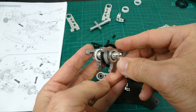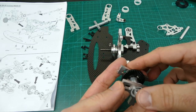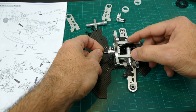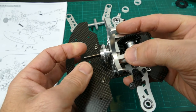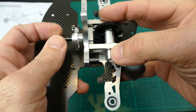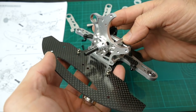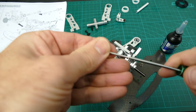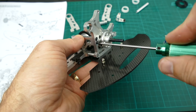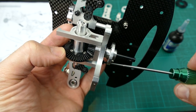That is how it looks when it's all put together, and now we can install it into the front bulkhead of the car. It just simply slots in, and once it's in there everything binds nicely and works very well. It's got two screws underneath and four at the front. The thread lock I use reacts really badly with plastic — it just cracks and makes it so brittle. So I'm really cautious not to get it near this plastic gear. These are the only Phillips-head screws in the whole kit — everything else is Allen key.